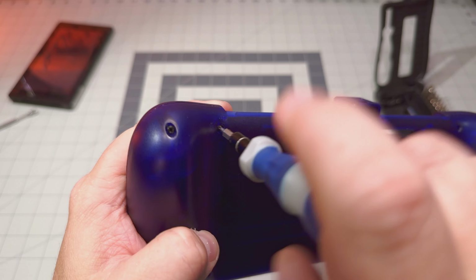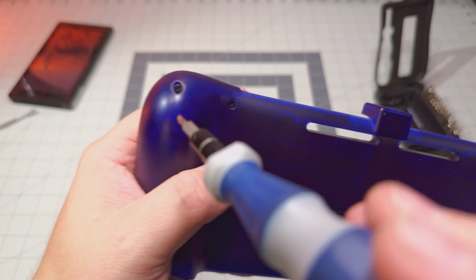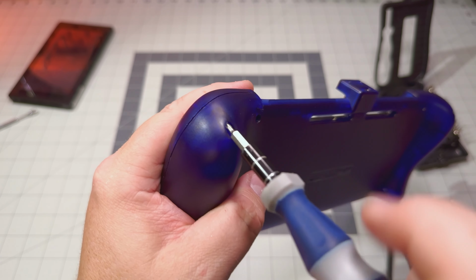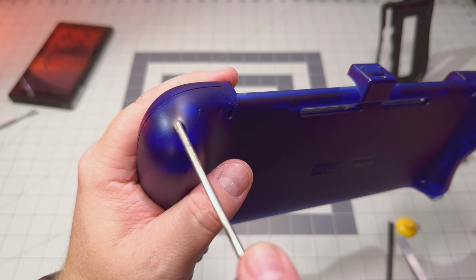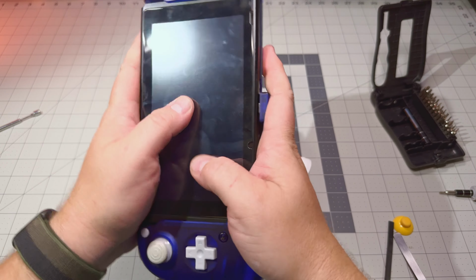I don't like using automated screwdrivers. I like using a manual one. I want to feel the torque. I want to feel how much pressure is being put on the screw. Especially with plastic, you really don't want to over tighten them. You're going to strip out the housing that's in there, and that's plastic too. So again, I wouldn't open up things repeatedly when they have these metal screws going into plastic receptacles. Every time you're putting those in and tightening it up, you're wearing away the receptor side. But again, these aren't made to be opened up repeatedly.